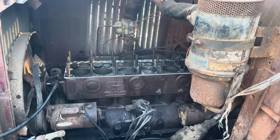And well, I think she's seen better days. Them are broke. That's the first. Normally, points don't break like that. We're going to have to go get a set of points, because them just ain't going to work for us. If we can't find a set, we can probably replace this little piece here off another set, but we need the whole set up here.